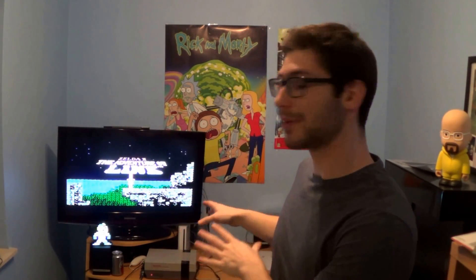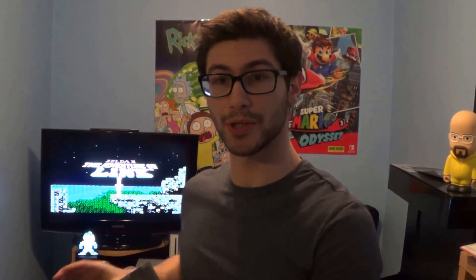To show you it's working, back here I have Zelda 2: Adventures of Link running on my PAL NES. Now I'm gonna put in Batman — as you can see it says USA, that's the seal for the NTSC version. I'm gonna put it into the console, turn it on, and you'll see it's not working. The console is on and the only thing happening is a black screen and a red light on the NES. The lockout chip, when it thinks the game is unlicensed, makes the CPU reboot every two seconds — that's why it blinks and won't load.